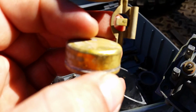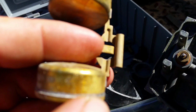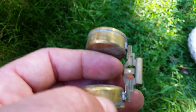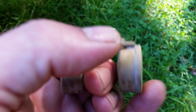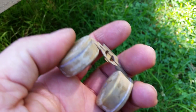You have your needle, this little tab right here rides on the needle. You can actually see the groove. There we go. You can actually see where that little circle in the center of it is where the needle was riding on it. There's a brass floats, don't squeeze them in. This one's already been squeezed in. It looks like a little dent on one side, but it's alright.